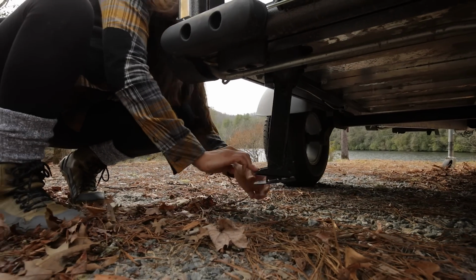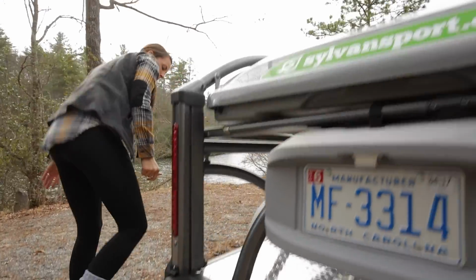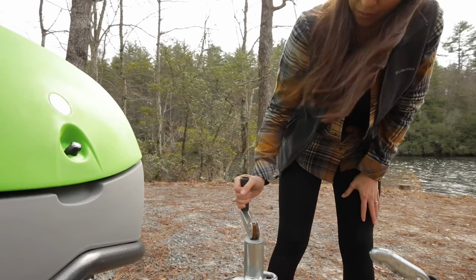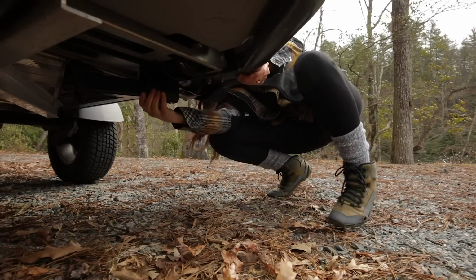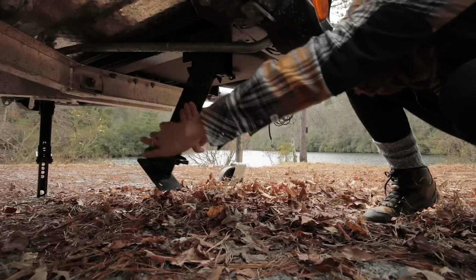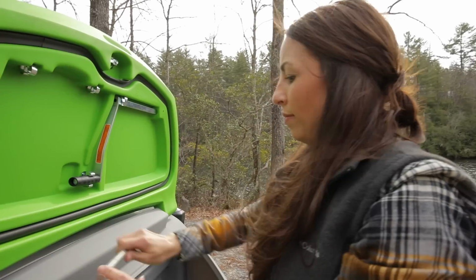Once the jack clicks into place, press down on the lever to release the foot and lower it so it is just touching the ground. Once the 2 rear jacks have been lowered, walk to the front of the trailer and crank the dolly jack up, or clockwise, 1 or 2 turns to weight the rear jacks. Once the rear jacks have been weighted, lower the 2 jacks located at the front corners and retrieve the stabilizer jack rod from the storage box.